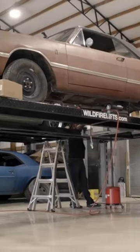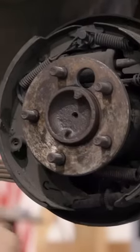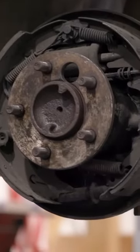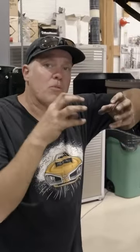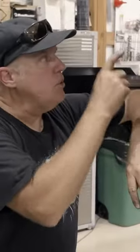The Mopar eight and three-quarter rear end is a little bit different than a typical muscle car rear end because you have to set the axle bearing end play. Think of when you put together a front disc or drum brake setup — you have two tapered roller bearings and you have to tighten the big nut just to get the preload just right. You're doing the same thing here.